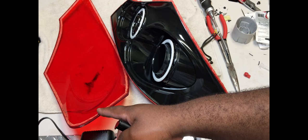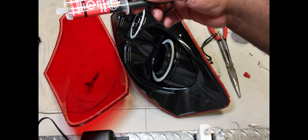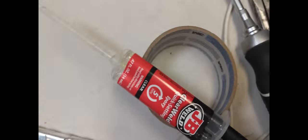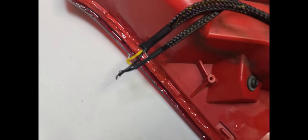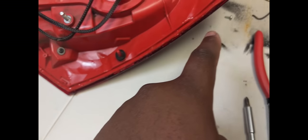It's now time to secure the glass front on to this. I bought some JB Weld Clear Weld quick setting epoxy - and it dries clear, which is very important. This light is all sealed up using the JB Weld epoxy. I put some on the inside, then I clamped it using a bag over there since I didn't have clamps. When it dried - I gave it 5 to 10 minutes to dry a little bit - then I worked around the edges on the outside just to give it a good seal.